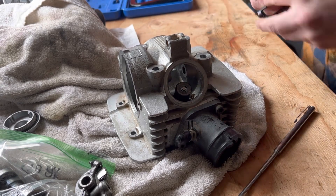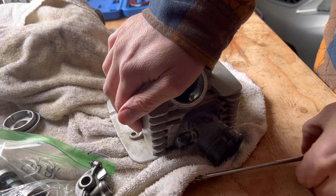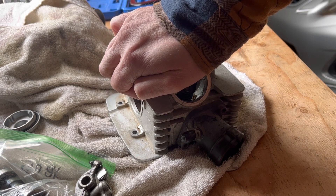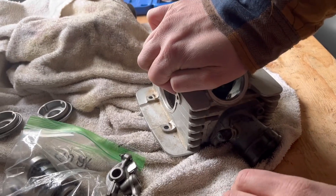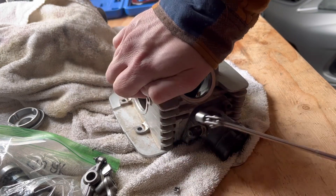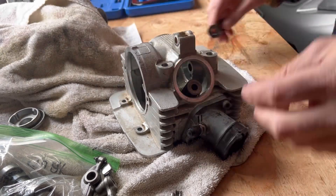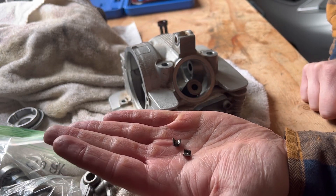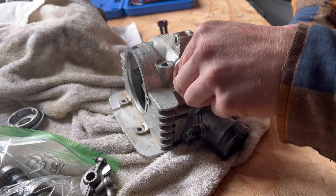Because I'm lazy and it's a smaller bike, I'm going to see if I can just push it down and get it with the magnet. I think I did — I just got to get the magnet in there and grab them. Got one. And there's the other one. So these are the collets — or keepers, I don't know what you'd call them. They go on either side, and I'll just pull the valve out. You can see the little groove that they connect in.